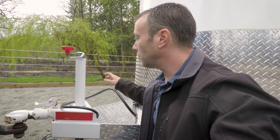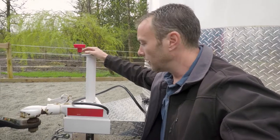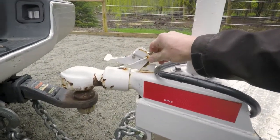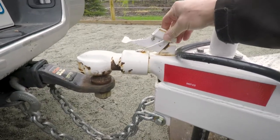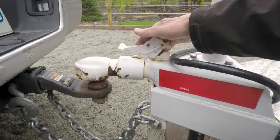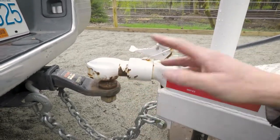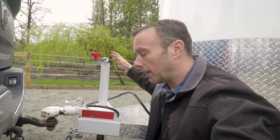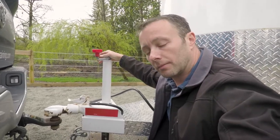And if you can — I've seen other people do it — another great tip is to completely cover this whole hitch area so that it will get less rusty. These things always tend to rust out; they don't last too long. There's a lot of friction that's going to take the paint off and then they end up rusting. But if you cover the connector with a plastic bag or something that keeps the water out, you can actually increase the longevity of it.